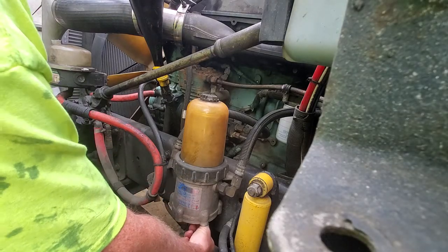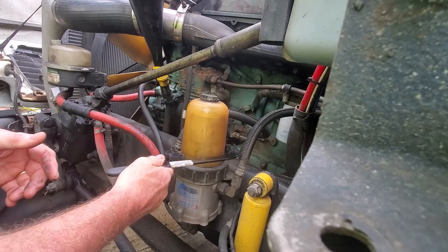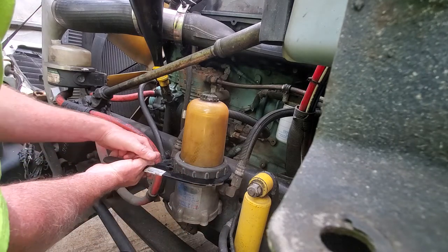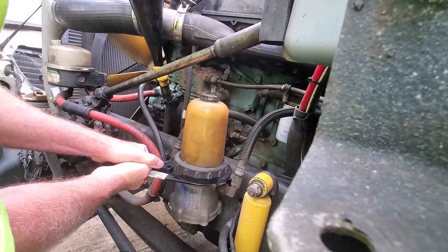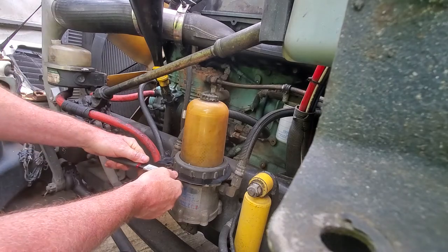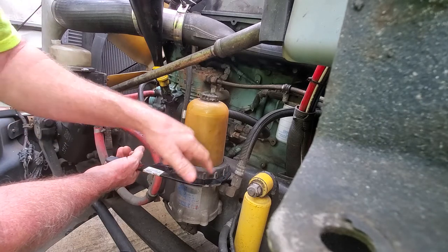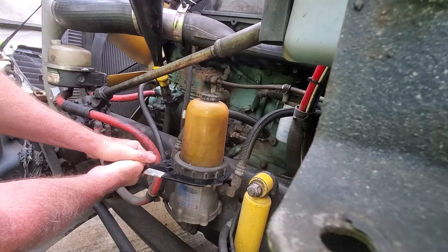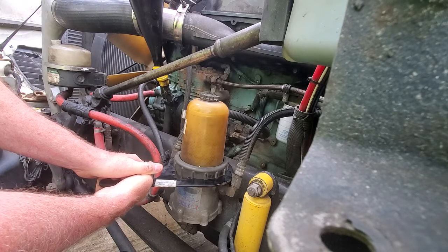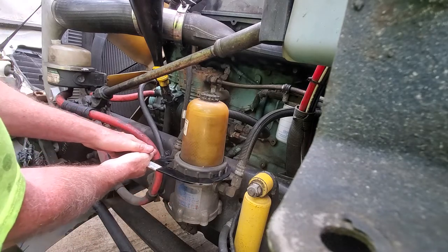Make sure it's not leaking and fully shut off. I use a fuel filter wrench — there are several different kinds — just to crack it loose. Put it on there all the way around and just turn it with a little bit of pressure. Do it one step at a time. Be sure it's all the way down so you don't strip the plastic little bumps that fit into all these notches — it's kind of like a 20-something-point socket. Be sure it fits snug.